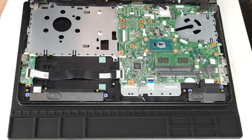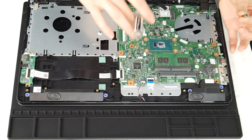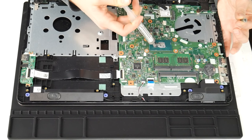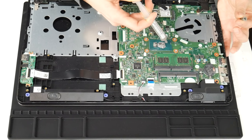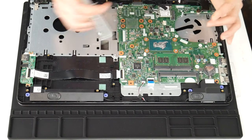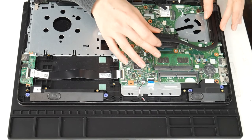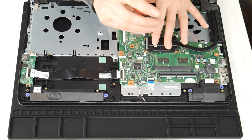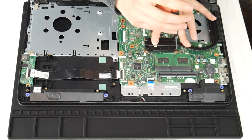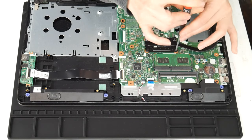The next thing I'm going to do is use some thermal paste on the CPU. I forgot to clean off the CPU before doing this, but I do recommend that. As you can see it's dried out and there isn't much on there, so I go ahead and put some new thermal paste. I've put a link down below with some good quality thermal paste, because not all thermal paste is created equal — get the good quality stuff. Then go ahead and put your heat sink back on. There are four screws and it's kind of like putting a tire on — you go one screw and then across to the other screw at an angle so that you don't get one side tighter than the other.